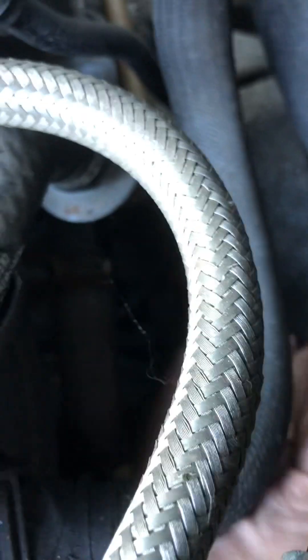We're going to change the crankshaft position sensor on the SLK. The sensor is actually taken off the covers. If you look past the back part, down this hole here, you'll see there's a bit of pipes in the way, there's a wire pipe down further, and if you can see through this gear, it's actually right down there. It's one of the ways we can get under there.